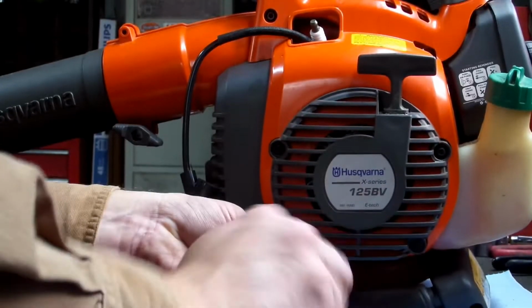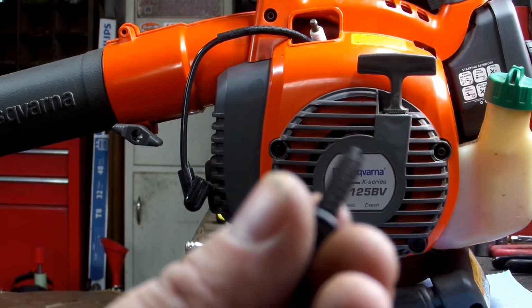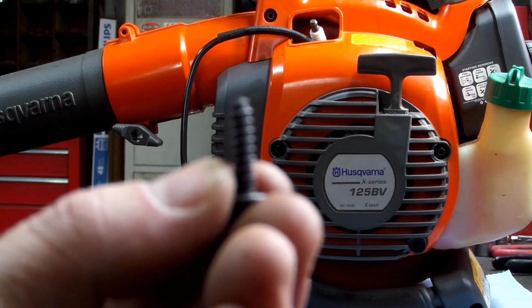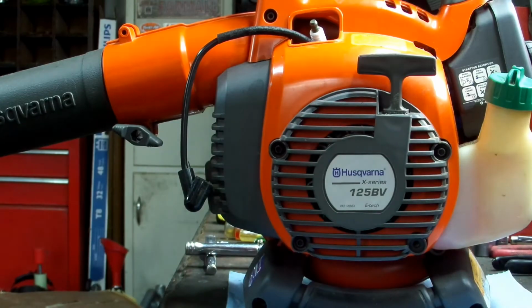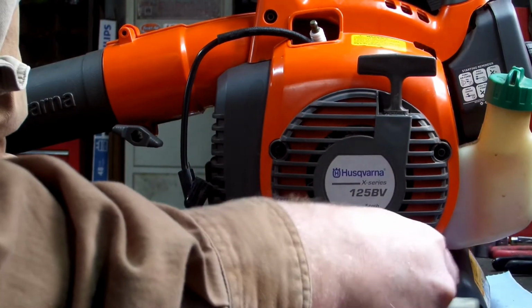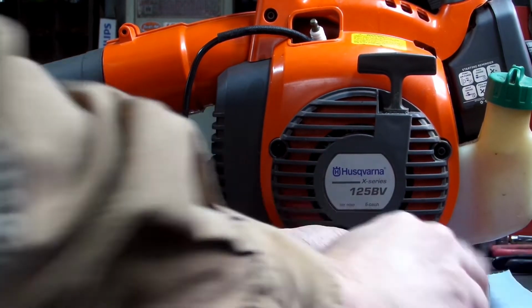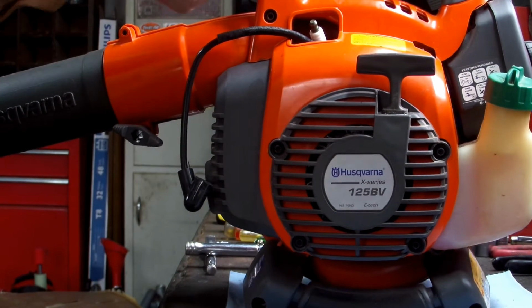And I'll show you the difference up close if you want me to. That's your plastic screw. I don't know why I don't want to focus today. See how big the threads are on it? That goes on your outside ones. Then you got this one, has smaller threads. Come on, focus. Oh well. Get all those in. The machine screws go into recoil because it screws in the metal. And your regular threaded screws go into plastic.